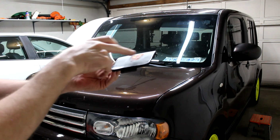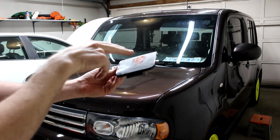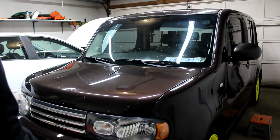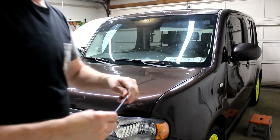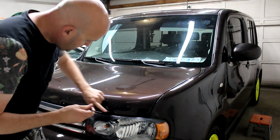So that's just got the finish coat of Bondo on it. I'll have to sand that down and give it another light skim of it, and then I just have to spot it for primer on that point, and then I'll have to spray it. I'm going to leave it out here in the garage because it's warmer, and for doing stuff like this I just use crappy little brushes from Dollarama or Dollar Tree.